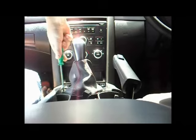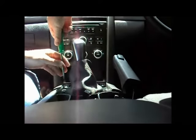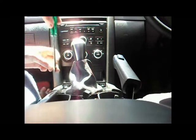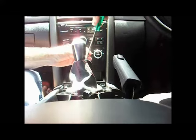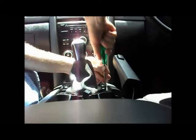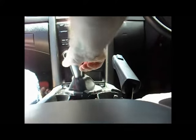Four screws go back in, so you're holding the retaining ring and reattaching it to your centre console. Once you put the four screws back in, you will need to apply a special technique to reattach your gear knob. Remember, it doesn't screw on — when you removed it, you pulled it straight off. That's the last screw going in there now, and then — bang! That's it! A couple of extra hits just to make sure, but it did only take one. And that's reattached.